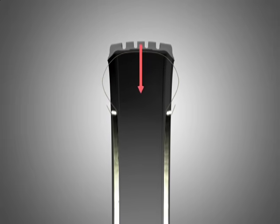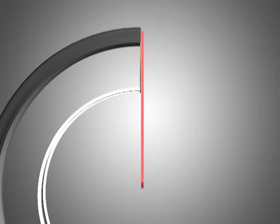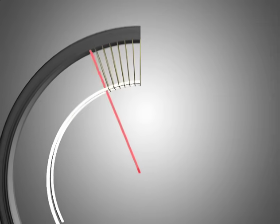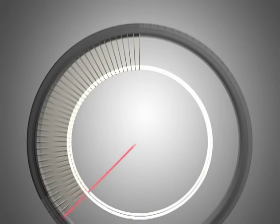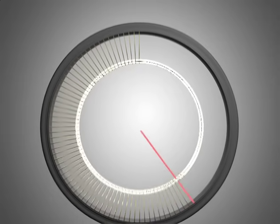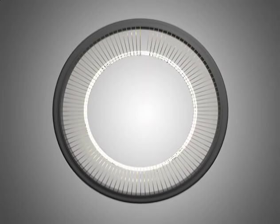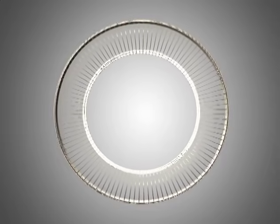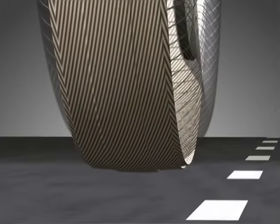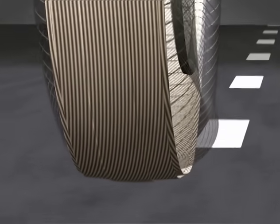If you draw a line from the center of the tread to the bead — a radius — you see that these radial lines match the steel cords, hence the name radial tire. As a group, these radial cords are called the body ply and run all the way around the tire. A typical truck tire has approximately 1,200 of these. Each cord runs from bead to bead and forms part of the sidewall. The sidewall does most of the flexing as the tire rolls — about 500 times per mile and hundreds of millions of times over the tire's life.